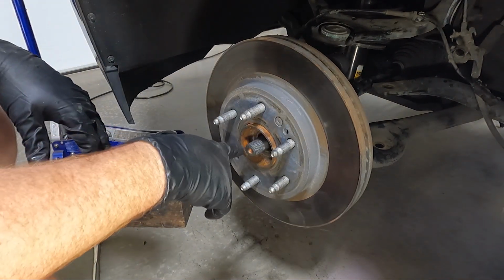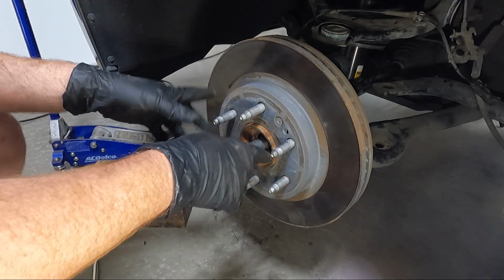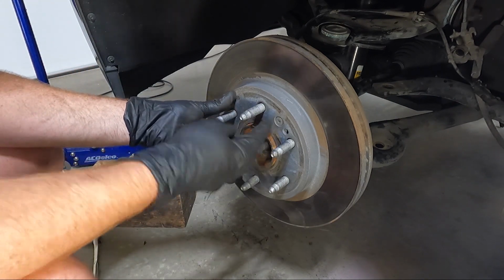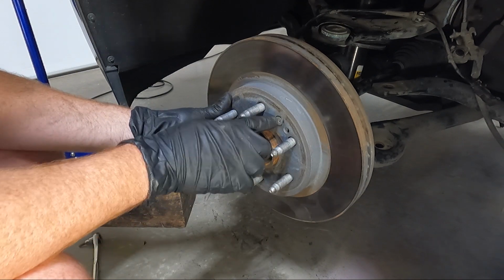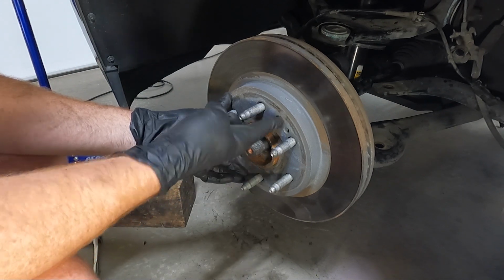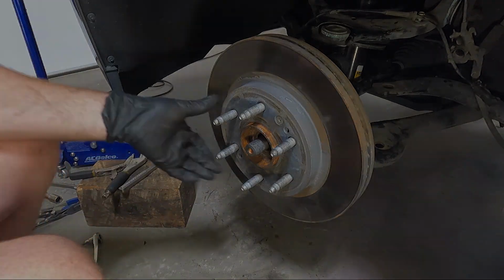And then we're gonna grab that washer and the nut, and you know, there's some people say you need to replace it anytime you take it off. I never have, just for lowering purposes. I'm gonna run it down with the impact as tight as my impact will go, but then once we get the wheel on and this thing's set on the ground, you need to pop your center cap out, because we're gonna torque it through the center of the wheel with the weight on it, because otherwise it's gonna wanna turn.